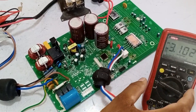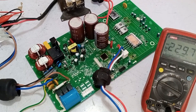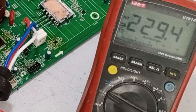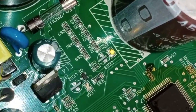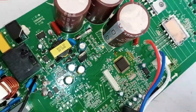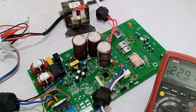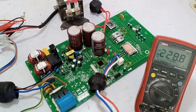I have removed it from its cover and set it up. Let's turn it on and provide it with electricity to check what issue is occurring. Now that we have provided electricity, we see 229 AC volts on the multimeter. You can see that the yellow light is blinking, but the other light is still off. This means that the high side is functioning correctly, but the low side is not working because its microcontroller has not turned on.